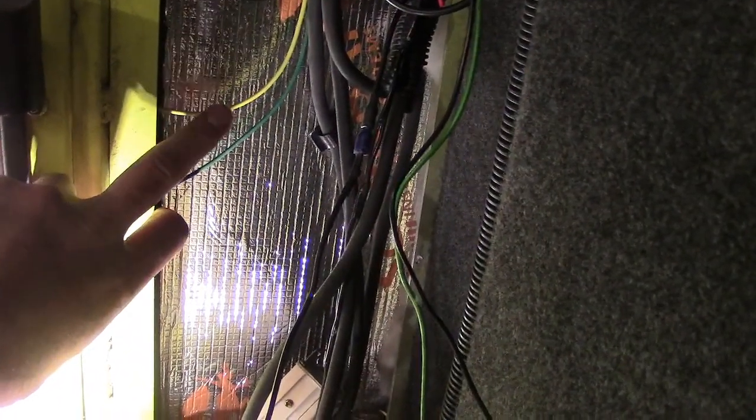The only point I can access the central locking - and this is how I know what color the wires are - is behind here. You can see the central locking wires: yellow and green. If I put a pulse to these using a power probe I can lock and unlock all the outside doors in the back, but it doesn't affect the cab. I'm assuming there's a break somewhere, or the wire's worn through, because I get a pulse but it doesn't even show up on a voltmeter - so it's going to be millivolts and it's not working.